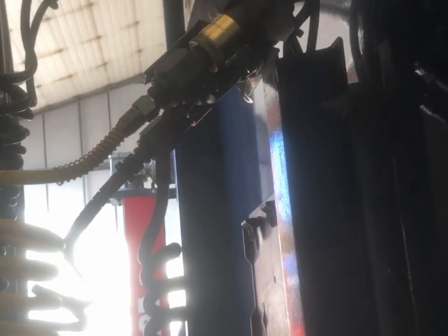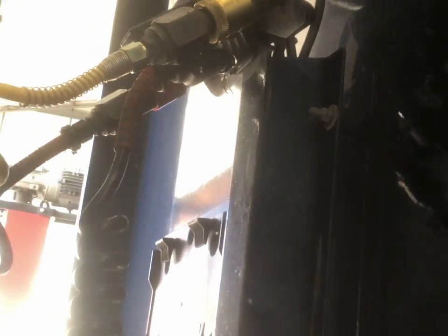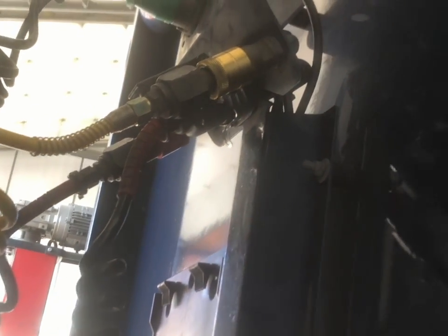The previous testing has come out inconclusive. So what we're going to do is bell each wire out from there to the plug at the ECU to check if each one's got a circuit. If one throws off or gives off high resistance, that'll be the wire to look at, as a few of the wires have been giving erratic data. So this will just confirm.